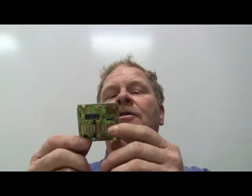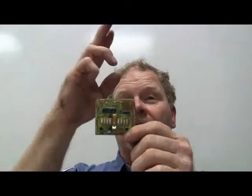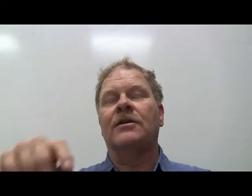Now, they actually got away from that by putting what they call a slosh module in there, and this is a slosh module out of a Ford instrument cluster. If you look at the way the printed circuit's done, it could go straight to the gauge, but it's clipped, and it goes through this on the way to the gauge. And this right here keeps it from responding too quickly. So if you're troubleshooting one of these vehicles that's got a slow-responding needle for slosh purposes, what you can do is switch off the vehicle, change your resistance, turn it back on, because it will correct more quickly when you first turn it back on.